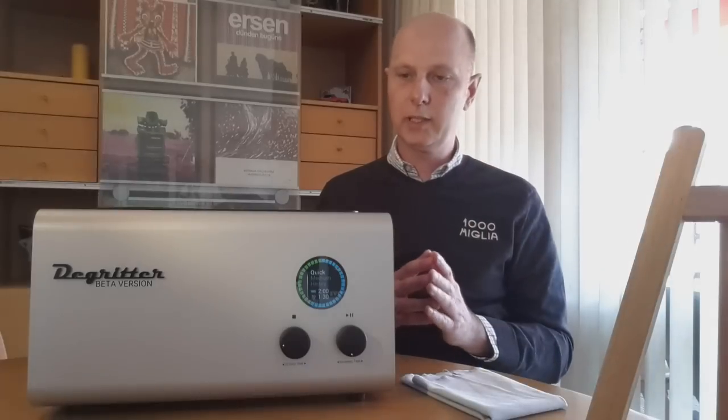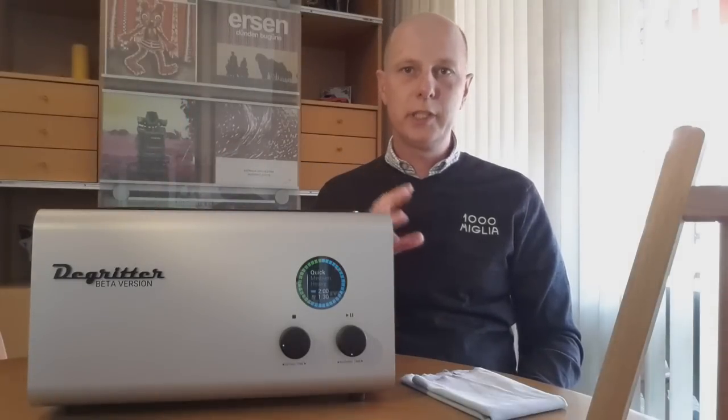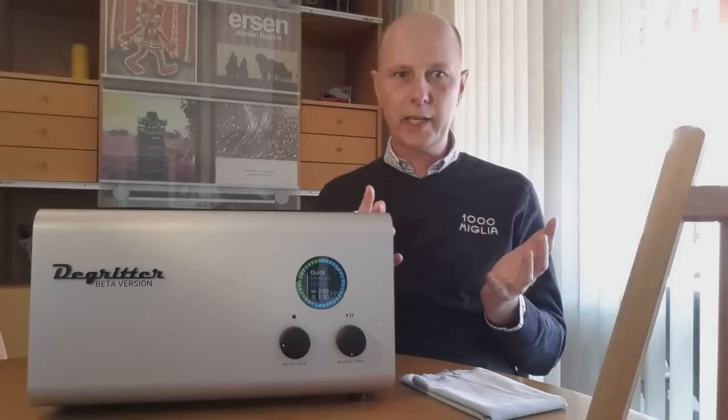For example, the transducers that make the ultrasonic are not at the bottom of the tank, because the bottom is also the width, so it would not fit. They've mounted them to the sides, two units on the left side and two on the other side. So they're continuously firing the bubbles to both sides of the record to help cleaning. Because that's also an effect that you see.